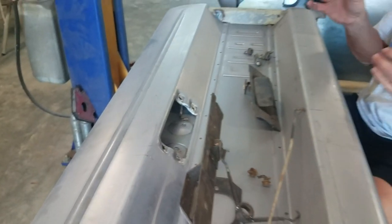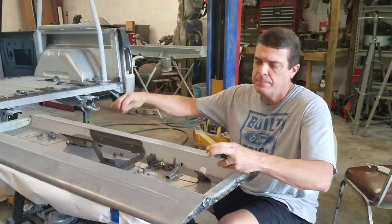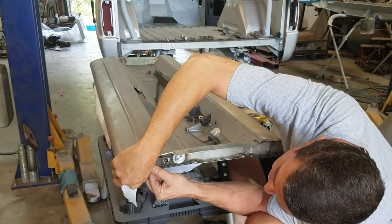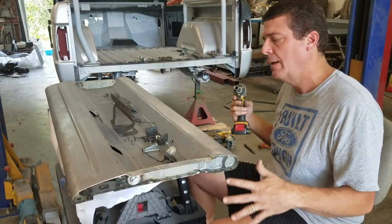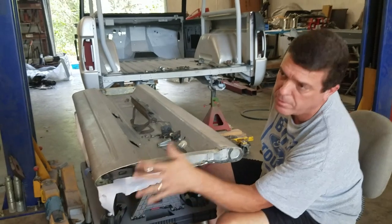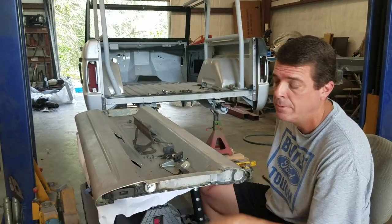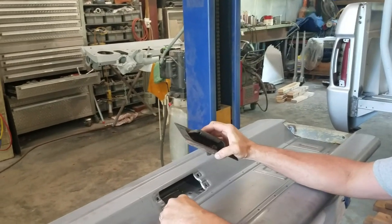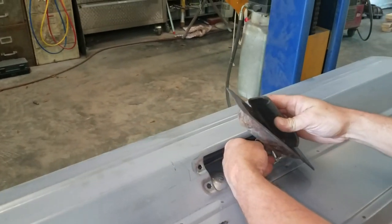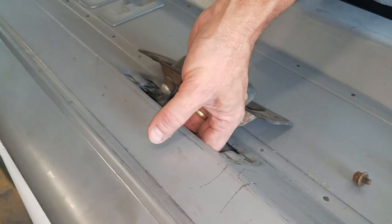It takes your 5/16th bolts. Same thing on this side with the beveled end down. I'm going to clean all these parts up and clean the tailgate up, but like everything else we have to fit it first. All of this is slotted so that it can be adjusted — once we get the tailgate up there we can start playing with the adjustment, sliding it in and out to loosen or tighten it, or to open or close the gap at the top. In the middle you should have two little keepers that go on your rods. Form and function first.